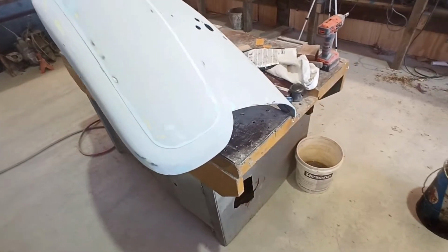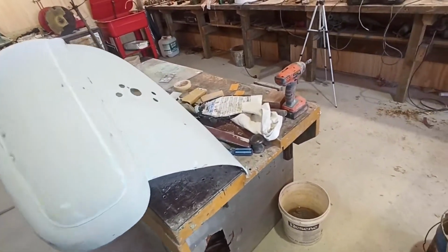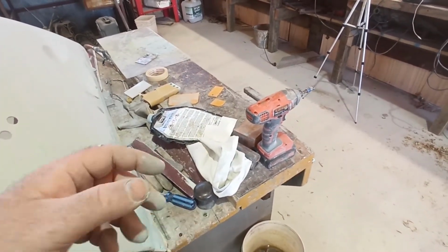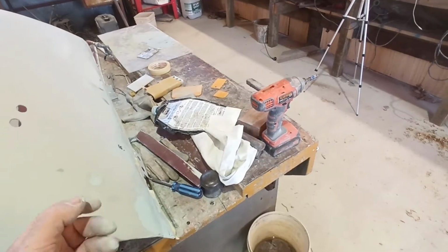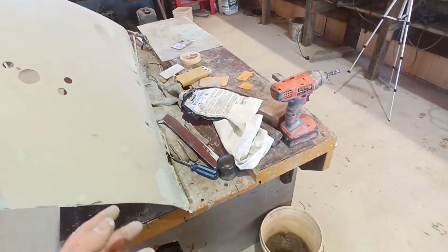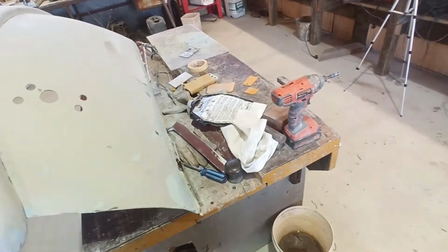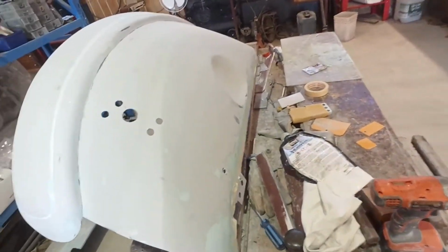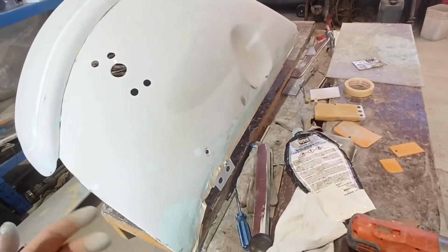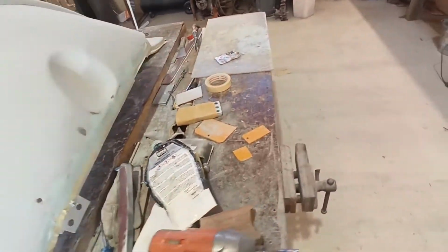That's the worst thing, knocking that top skin off the stuff. I don't know whether it's because this is about a year old now too, and I just don't know whether it's because it's got a little bit of age in it. It stays gummy on top, or what it is. It says 2% hardener, so I'm putting more than 2% in it, probably 5. Not heaps, but you know what I mean, a decent little dollop. I still seem to get that. It just fills the paper up on top.